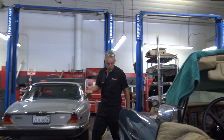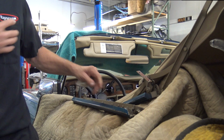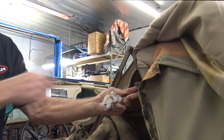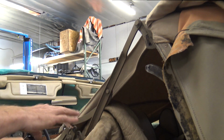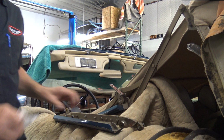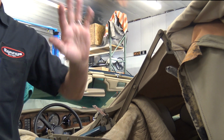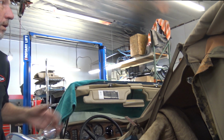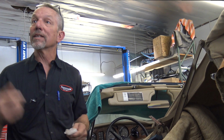This is not the first time I've seen this. The pivot that usually breaks is this one right here. It connects to this, so you have a bolt that goes through there. This connects to the hydraulic ram, and the ram does the levering for all of these articulated joints. So usually it breaks a pivot, and I have replaced the pivots, no big deal. Does it make noise when it breaks? Oh, it makes a noise, yeah.